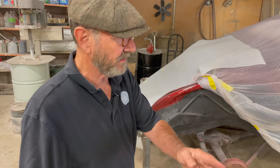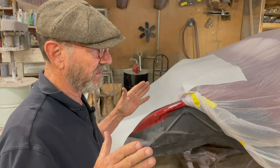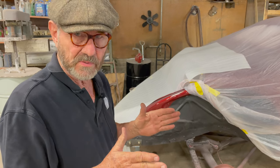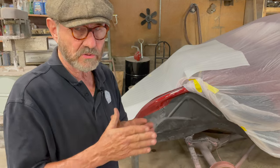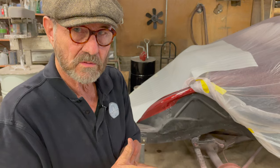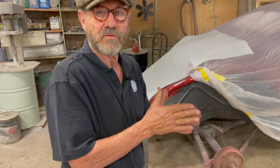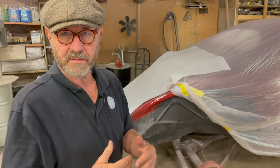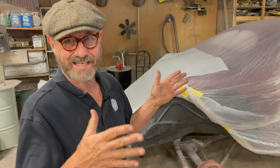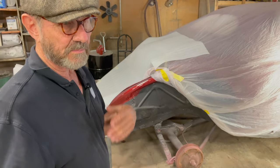All of the old stuff is going to be gone, and then our new nine-inch rear end with new hubs and new axles — everything made to be exactly the same width as stock. That whole rear end had to be built to fit exactly in here because we have no space between the outside of the tire and the skirt. It's got to be exactly right — we can't have any deviations. The axle tubes and axles had to be made to exactly the right width.